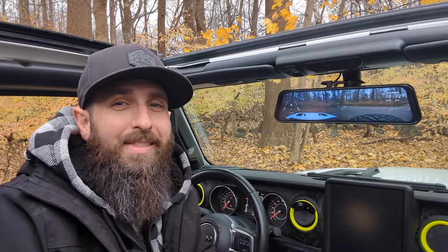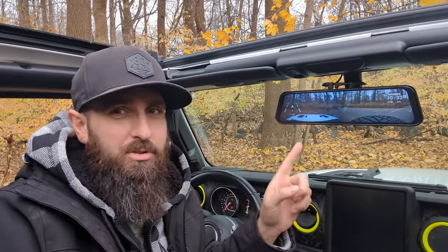The first upgrade was the camera upgrade. As you can see, the stock camera that comes with this system is just not that good at night — it is not able to handle direct headlights. It causes major lens flare and makes it almost invisible through the screen. With the WDR camera, this was dramatically improved and you can actually see the vehicles behind you. The next two upgrades were the matte screen protector, which I definitely recommend because it reduces the glare from either headlights or the sun and gives you the ability to actually see the image through the digital screen.